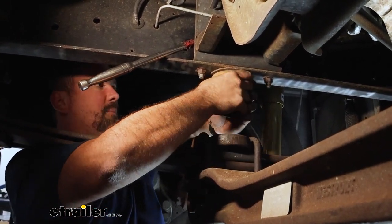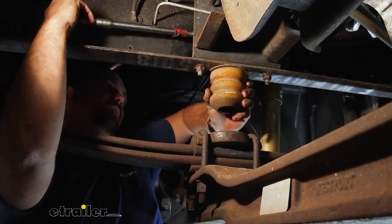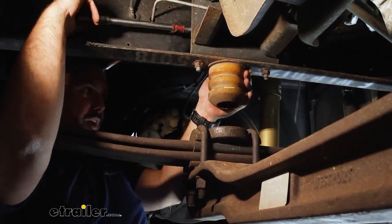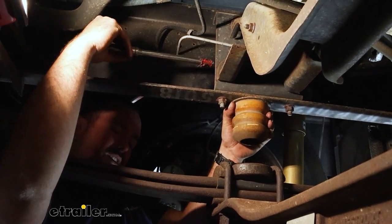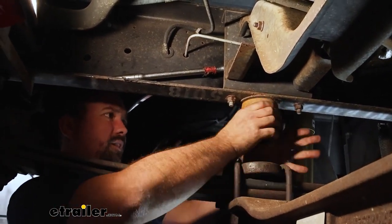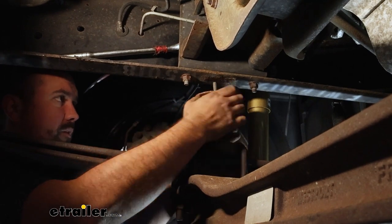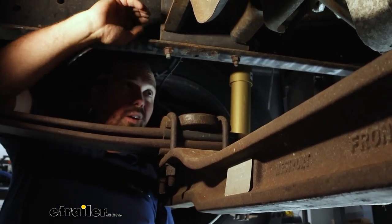Just being underneath the vehicle, it's going to see road grime. If I can just get that knocked loose just a little bit, that should allow us to get this spun off pretty easily. Something I might suggest — if you have an oil filter strap wrench, you could put that on your old jounce bumper and that's going to help loosen it up and give you a little more power on it. I've gone ahead and got that loose — just spin this while I have my socket in place. It's a pretty long stud here, so just keep spinning until you get this removed. So that's off — grab that nut and we'll get ready to put our new Sumo Spring in.